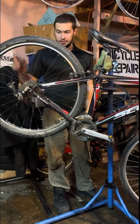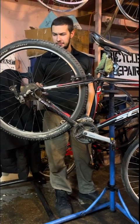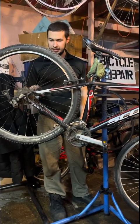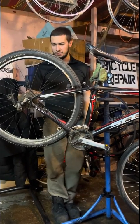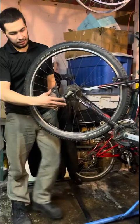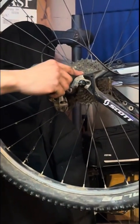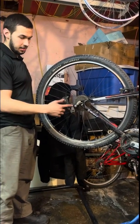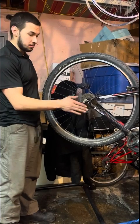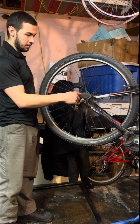I bought a set of M201S brakes, Shimano. We're going to stick them on the back. I got the proper post adapter and the spacers. This hub I wanted, so this derailleur is 9-speed compatible. There's 8 speeds here, obviously not right. So that's good, because none of these exist anywhere. So I'll be using this puppy and putting a 9-speed cassette here.